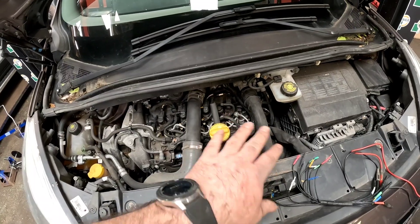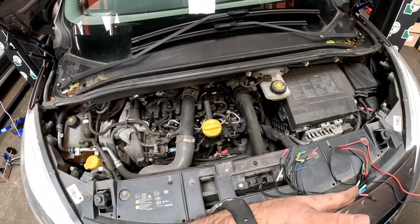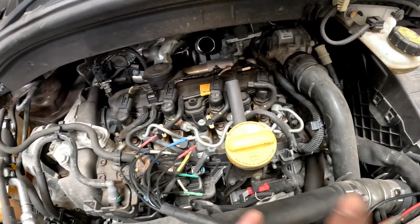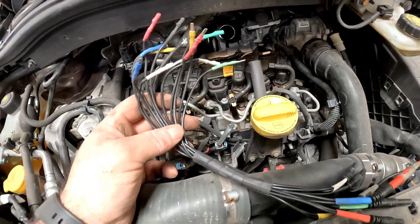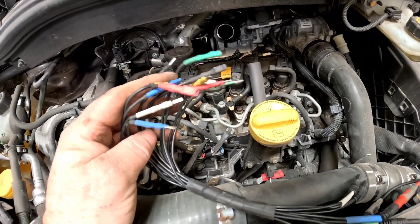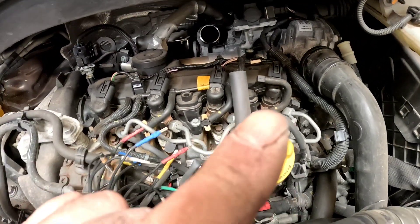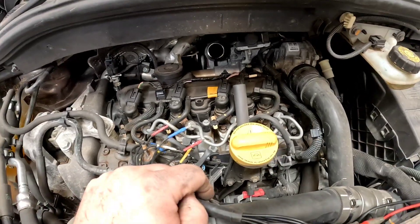So we're just going to check on with the sensor box. I'm going to go with this injector being faulty — it might test good, but I think it's suspect. I think this injector is breaking down only when it's hot. It hasn't completely failed as yet, but we're just going to put some breakout leads on it and test the resistance on all the injectors.